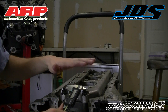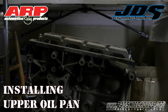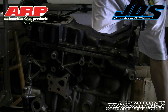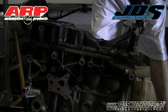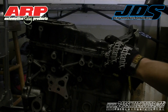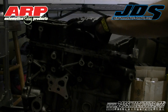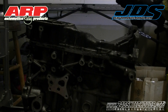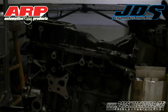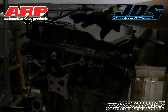But now we're going to install the upper oil pan on top to see how much clearance we actually have. We're going to take the upper oil pan and install it on. We're going to take a rubber mallet and lightly tap it down and knock the oil pan onto the dowels. You want to hit it in the center as much as possible to keep it as level as possible, because if you're knocking on one side it's going to pull the other side up, because it is hitting the main studs.